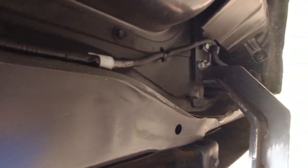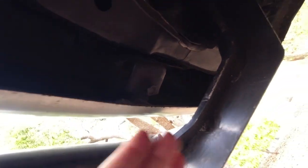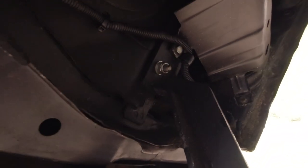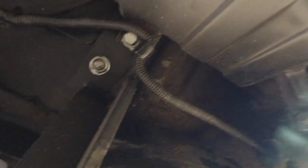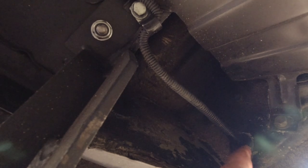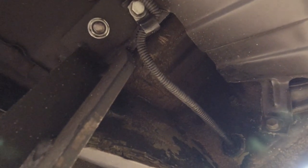Like we checked the front of the vehicle, behind the front bumper, you want to make sure that the metal is nice and straight, looking towards the back of the car, that there's no pushed in bits or dents, indicating that the car's been in an accident and they've just replaced the bumper. So again, we're looking at the other side of the chassis rail now, making sure that it's nice and consistent, and referencing the other side, that it's nice and straight as well. And again, you have little bungs like this here for certain drainage components.